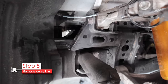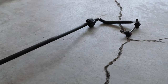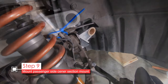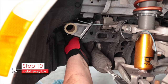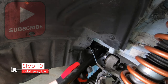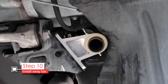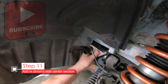Here's a straight shot of the tunnel that the sway bar was running through. Now let's install the center section mount — you want to start with the passenger side first. Just mount it on the subframe, but no need to bolt it down quite yet. Now move over to the driver side. You may be tempted to put in the other center section mount, but don't do that — we need to put the bar in first. Slide the bar in and work it all the way over to the passenger side. It's nice to have a friend help you, but if you're doing it solo, just lay on the ground and guide the bar over to the other center section mount. Try not to bang into the center section mount as it could put stress on the studs. Some gentle twisting will help get the bar to slide through. Now install the driver side mount and install the nuts, but don't tighten them down quite yet.